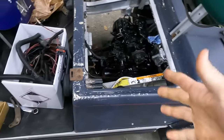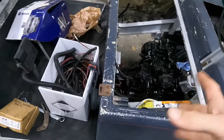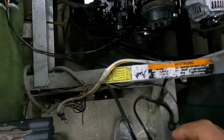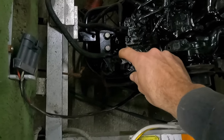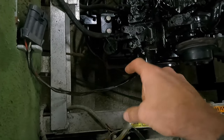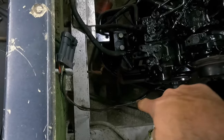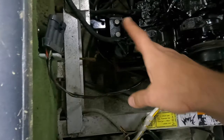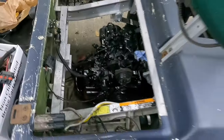Yeah, there's still obviously plenty more to do. The wiring, I kind of halfway know what's going on, but we'll address that later. There's a lot of little things to do here, and this is the first time I'm doing something like this. So we've got to make a little throttle assembly to take this direction and somehow be able to move it this direction. So what I'm thinking is we'll make a little rod with some bearings or something in it to where when we push this way, there'll be an arm that pushes this way, and then another one that will supplementally push out, so we'll get our throttle control. But all in all, we're looking pretty good, I think.